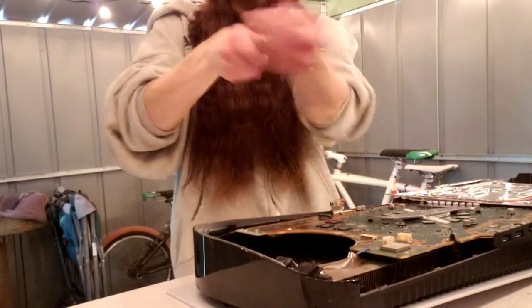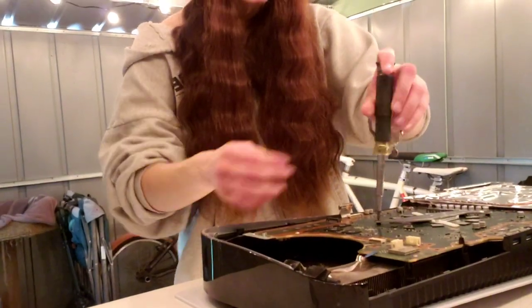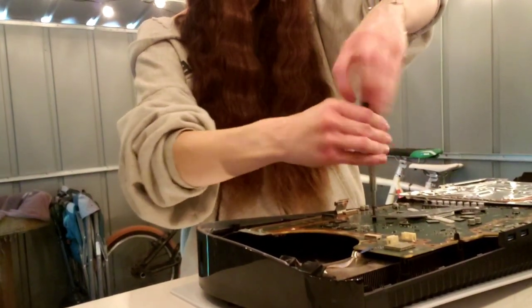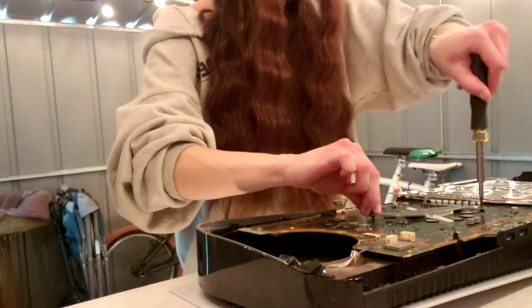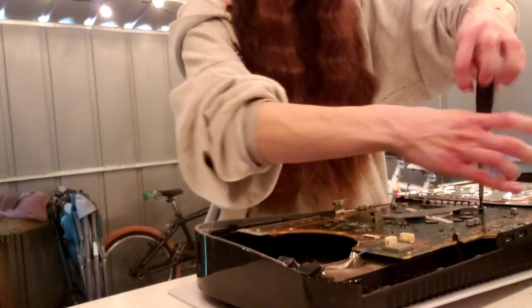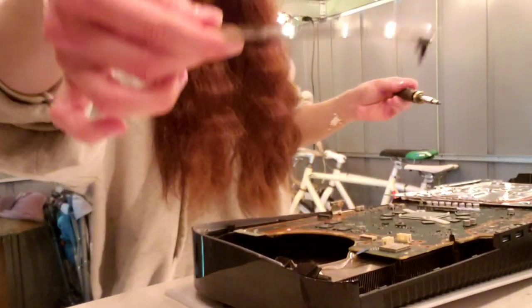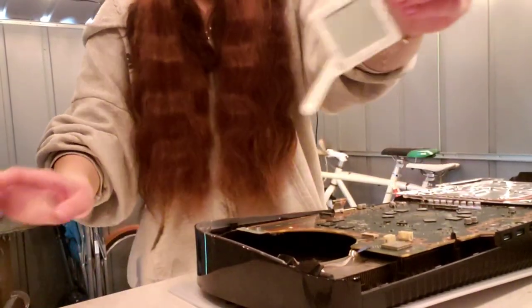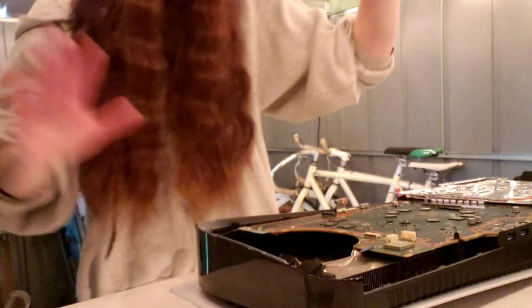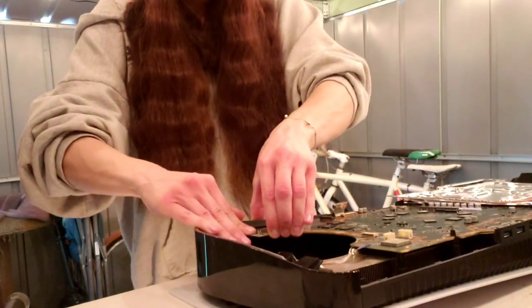And then you're gonna go back to your Phillips head. There we go. And then you're gonna take out the heatsink screws, which are the most important screws. If you lose them, it's gonna be very bad. So then we're gonna move this. Okay, now, drum roll, now we can remove the motherboard. Here we go.